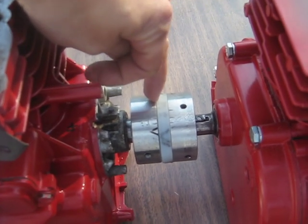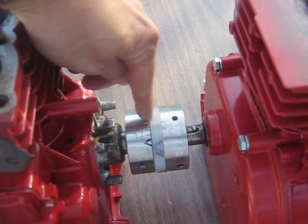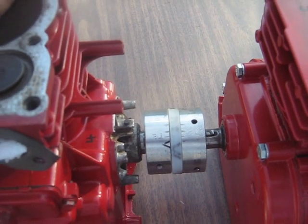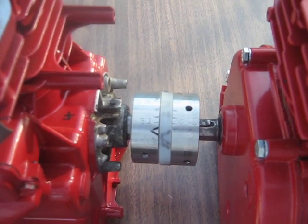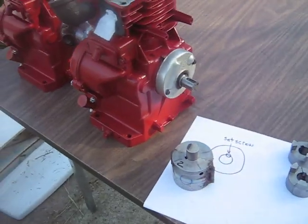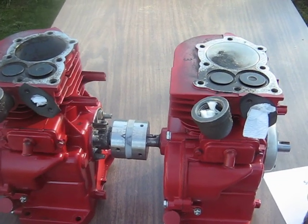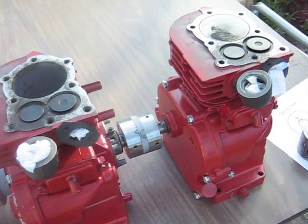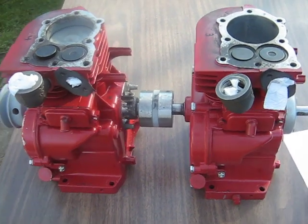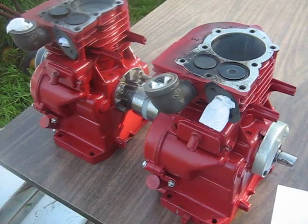I think the way to solve it is to machine the face of this disc. I've measured and the disc itself is true to about half a thousandths of an inch — I had to sand it to get it that way. When I welded it, it swelled up in a few places. So I'm working on this Frankenbriggs build here, just having some difficulties. The amount of misalignment it has would shake itself apart in no time. Anyway, just wanted to update you on that — have a good one.